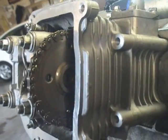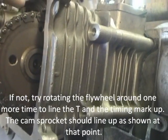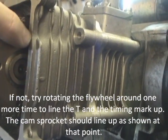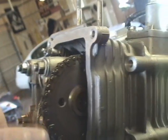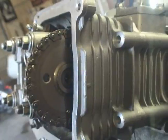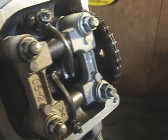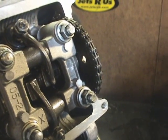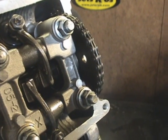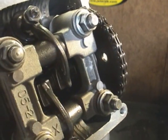When that's lined up, hopefully you'll see that these three holes are aligned as you're seeing here — these two just parallel, just about level with this surface, and the big hole perpendicular all the way at the top. When it's timed up like this, both of the rocker arms should be on the base circle of the camshaft. You can move it around a little bit and you won't see them move. That's what you're looking for — you need the valves to be completely closed.